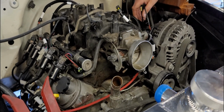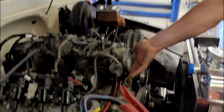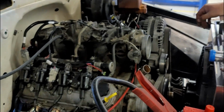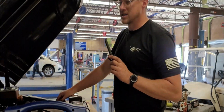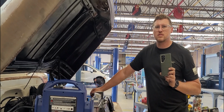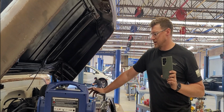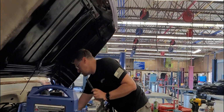All right, so we're down to a mechanical issue. So it has to, but I just don't know, man. If it has that much of an air leak, there's no way that it would create that much suction. So it needs less air. So is it not getting enough fuel? Right, that would make sense, right? It needs less air, then it's not getting enough fuel. It definitely sounded like it was firing on all 8.